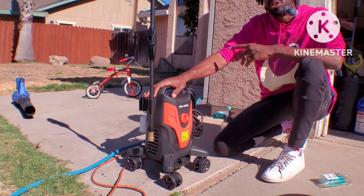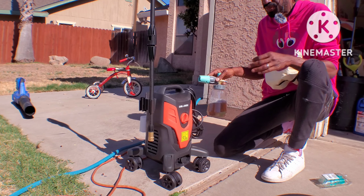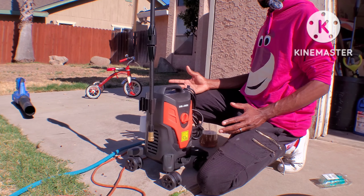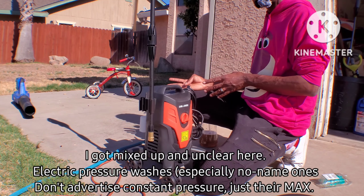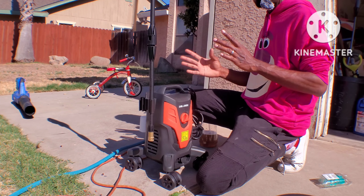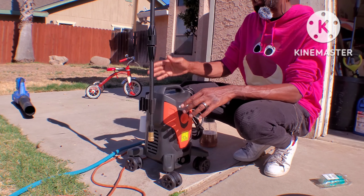And finally, you will need your pressure washer, of course, your hose, an extension cord or a power outlet, along with a foam cannon. What this allows you to do is basically generate high pressure. When it comes to a pressure washer, I would recommend something somewhere in between 1500 to 2300 PSI. These are generally rated at the first second of maximum pressure, or with a zero coming out, or through, I think it's the soap bottle it comes with. So it's not going to get that once you get your attachments.